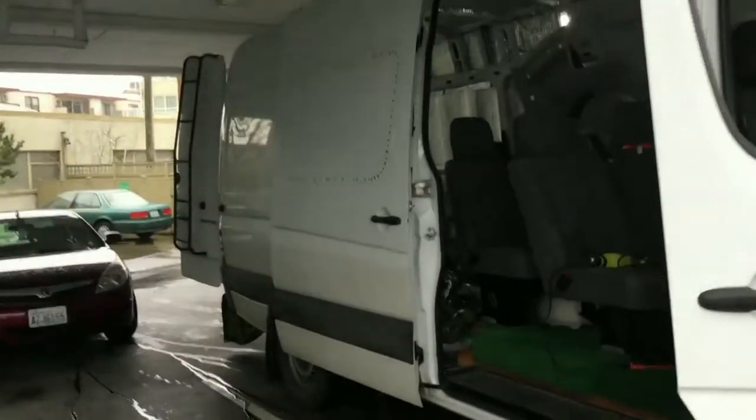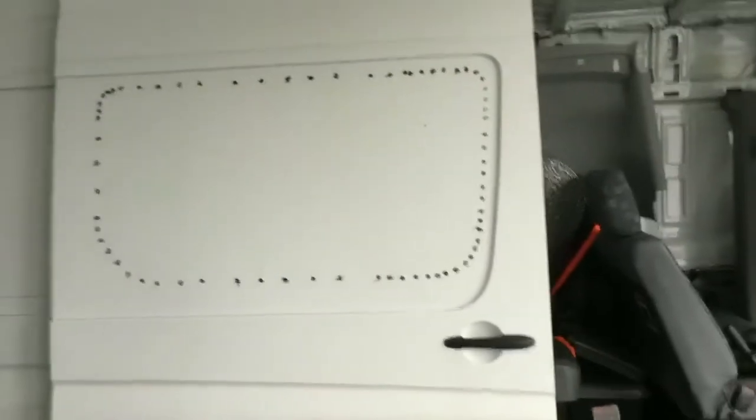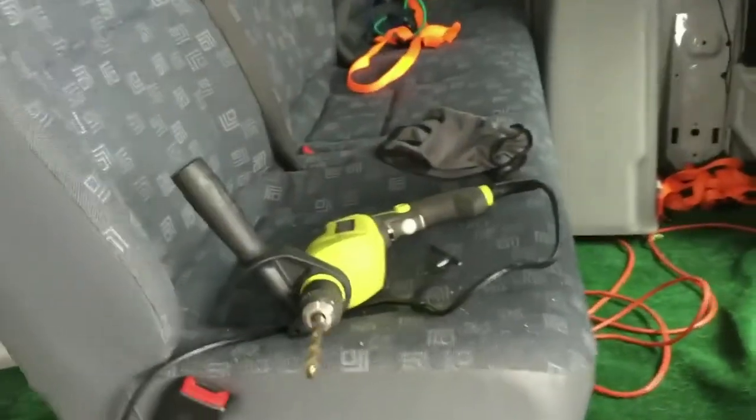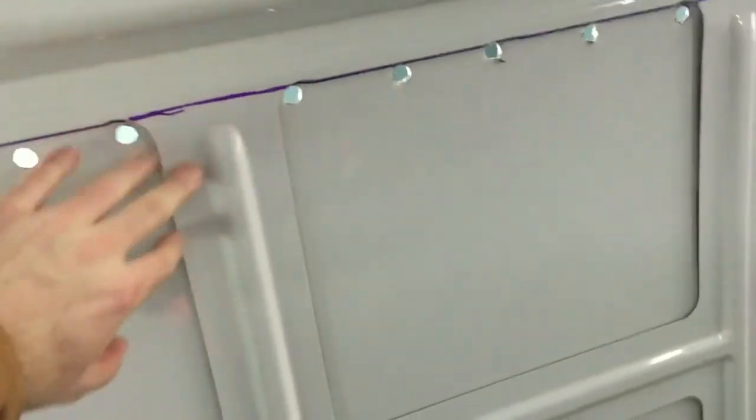This is a Sprinter 170 wheelbase 2500, one axle, single tire. Today we're talking about a window installation in the sliding door. We've drilled all the holes with a normal drill gun. We drill them from the inside — from the outside it doesn't look like much, but from the inside you can see it follows the guide post, because it doubles up — there are two layers. We follow the guide from the inside, drilling all the holes around, and where there's a post, go around on either side; don't try to drill through. The next step will be jigsawing all the way around the edges.